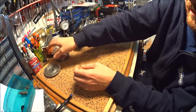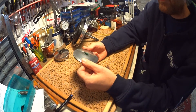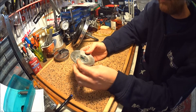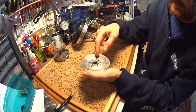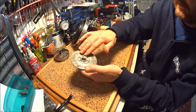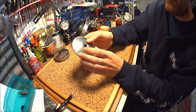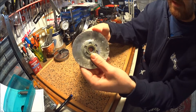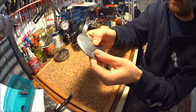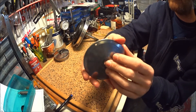I can start with the inner sheave. I think it's from a Yamaha scooter — not quite sure. What I've done with it: it comes with cooling fins on the back side and I've ground those off. The inner bore is larger than my crank, so I glued a washer to the back and pressed in a bushing to make it fit the crank. That hole is from when I was triggering the ignition from this variator sheave.